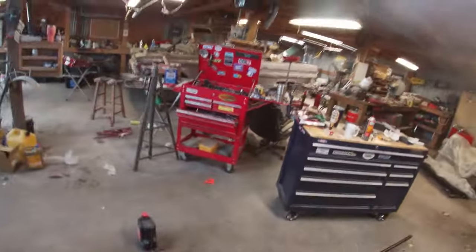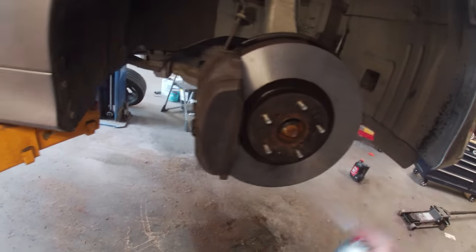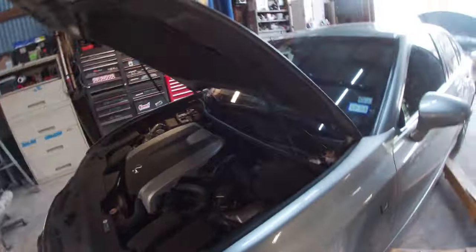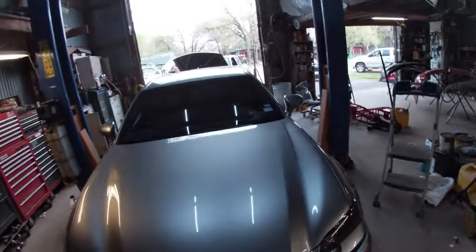Once you're done with that, this is just about ready for the tire. Make sure you use some brake cleaner and knock off all the greasy handprints and stuff on your rotors — that's very important. Tires on the ground — don't forget you need to pump your brakes up before you start moving because we had depressed all those calipers. Also don't forget to put your brake fluid reservoir cap back on. Hit that thumbs up button if this video helped you out. I'll have parts, tools, everything you need to do this job in the description through Amazon. Thanks for watching.